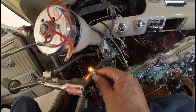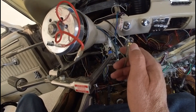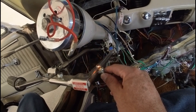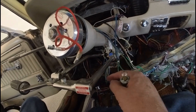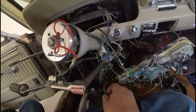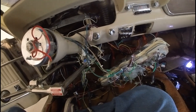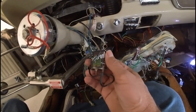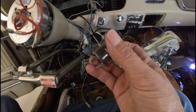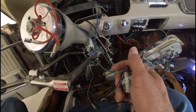After doing a little research, I found out that these thermal flashers require a minimum amp draw, and I wasn't getting it with just a single light bulb. Without the amp draw, the flasher will not pull on the little thermal connector inside that makes it bump and flash. And that, by the way, is the reason why they tell you to use electronic flashers anytime you're using LED lights — the LED lights will not pull enough amp draw to cause that thermal flasher to click.